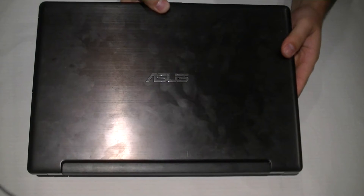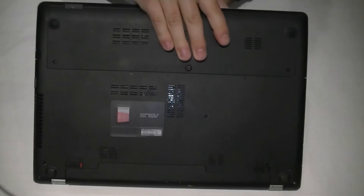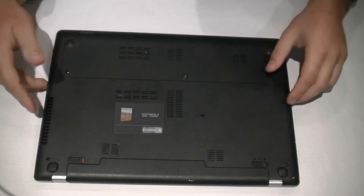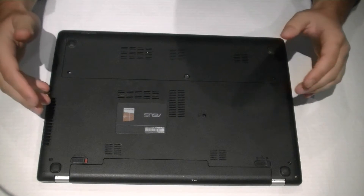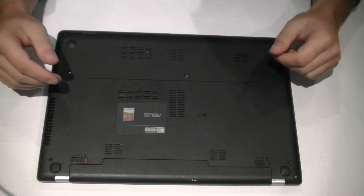What we have here is an ASUS laptop and it's got a screen flicker. I'm going to show you how to fix it. What you want to do is plug it into an HDMI cable and into the back of your TV, just to make sure that it's not your GPU. If you still have your screen problems after plugging it into the TV via HDMI, you most likely have a GPU issue.